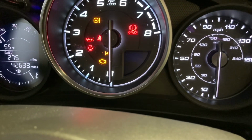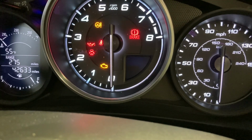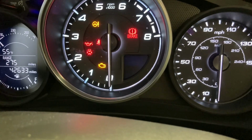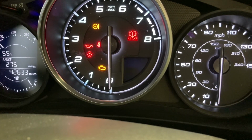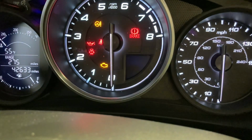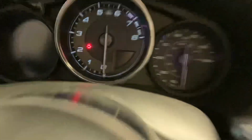They said you're supposed to put your foot to the floor with the gas pedal. I did not. All I did was crank it for a couple of seconds, stop, so your starter doesn't overheat. Cranked it again. I did that until this oil light went out. Once the oil light went out, I knew I had pressure. So then I shut everything off.